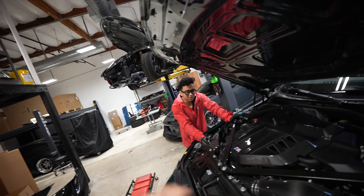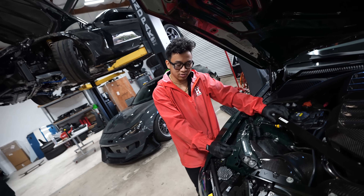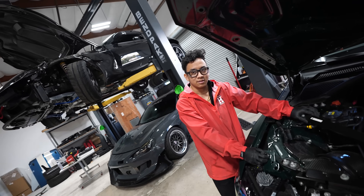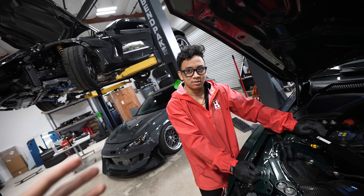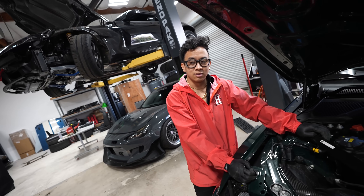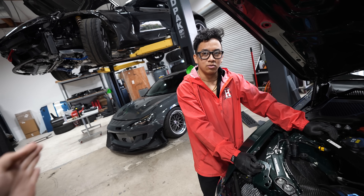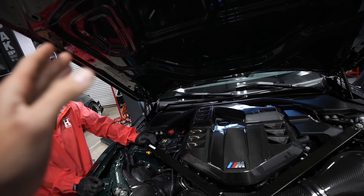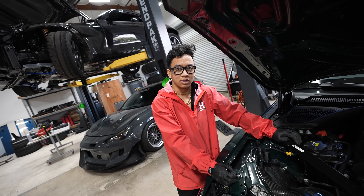This is a video we should have done a long time ago. When we did the exhaust on the M4 it made it louder, but not as loud as I think we all really appreciate. So here's the thing — the car has the valvetronic exhaust on it right now. Rather than using the valves that the valvetronic exhaust comes with, we kept the OEM valves. The OEM valves only open 30 percent, but the aftermarket valves open 100 percent. So right now when we go max volume, we're really not even getting max volume — it's technically a pretty big restriction.